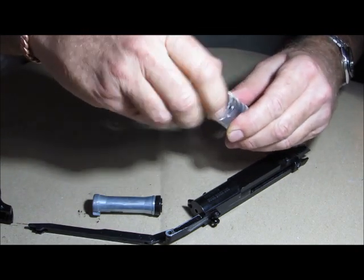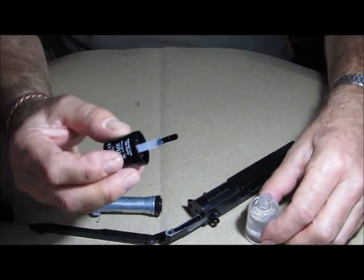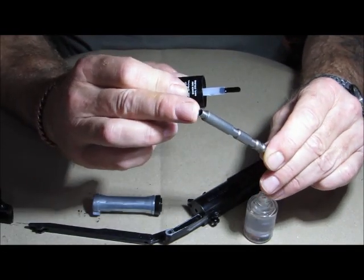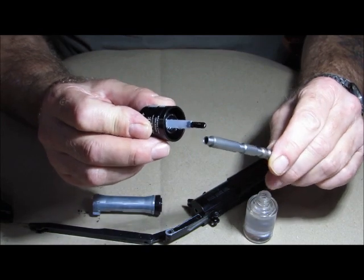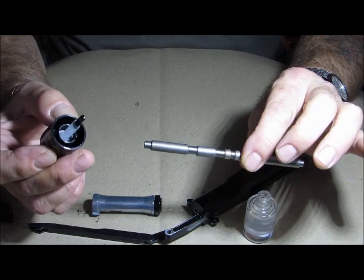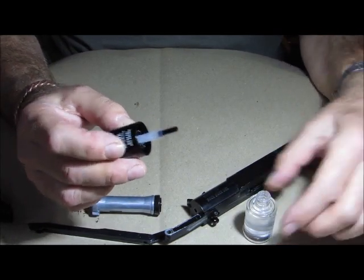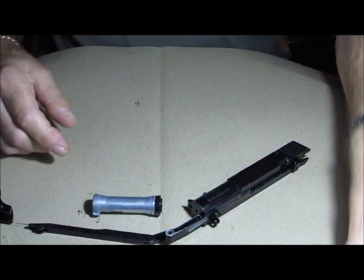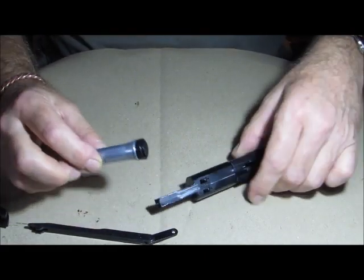Before putting it back together, I've got this clear nail varnish — just cheap stuff from a pound shop. When you cock these guns the barrel feels a bit loose and wiggly. I tried to find washers to fit either side but the gap is quite small. The trick I used to do with action figures when the limbs came loose is to give them clear nail varnish, move it around, leave it to dry, then crack the seal — that tightens the joints up. So I gave it a few coats. It's not going to last forever but it does make it feel tighter. Get any grease off first, give it a few coats, leave to dry. Also, just before you put the barrel back in, put a touch of nail varnish around the bottom half of the barrel end — push the barrel straight in and that should give you a nice seal.